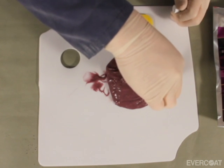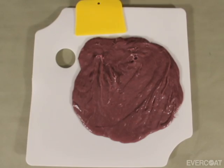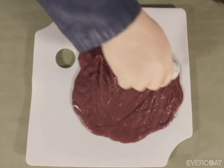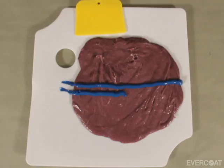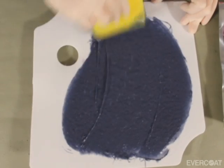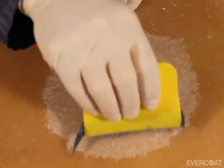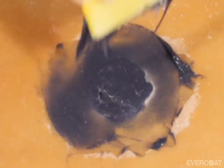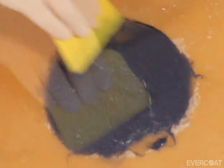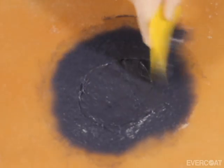For a 4-inch puddle (about 10 centimeters), apply a bead of cream hardener from edge to edge. An 8-inch puddle, or 20 centimeters, requires a bead of hardener from edge to edge plus an additional 4-inch, or 10-centimeter, bead. When mixing, use firm downward pressure to press out any potential air pockets and ensure an even blend. For the initial application, use firm even pressure to press the material into the repair and wet the surface. Build up the repair material to the plane of repair. Remove any excess repair material that extended beyond the prepared area before it begins to gel.